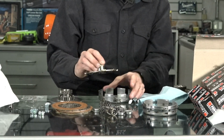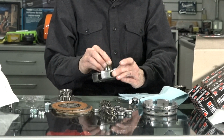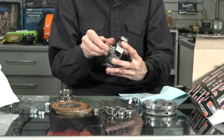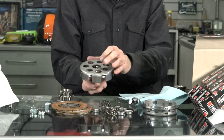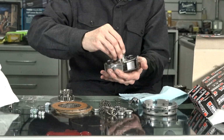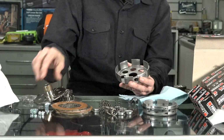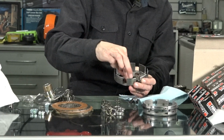There is a hole right here. You want to make sure they're lined up. Sometimes they don't have that hole there, but you can kind of see how those are pretty close to lined up. They're not perfect, but in some cases they're way off. So you got to find where it's pretty close. And if it's got that little hole like this aftermarket clutch, that's the position it's going to go, just like that. And drop all the cups in there. Usually use new springs.